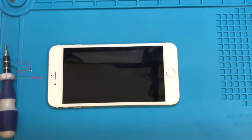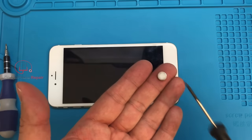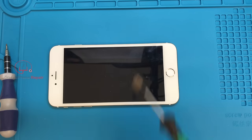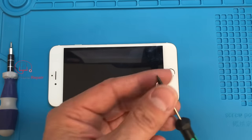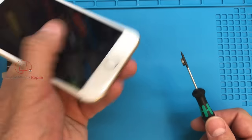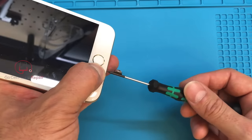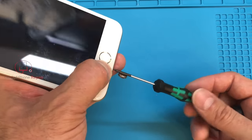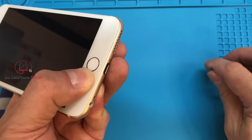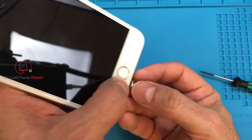I can go back and magnetize again, or I have another option — a rare earth magnet. If you haven't seen these before, they're super strong magnets and you want to be very careful with them, especially when you're working inside of a phone. Now that we have a very strong magnet on the end of this, I'm going to put that slight pressure on the screen, put the blade down in here, and very gently without pushing against it, I'm just going to turn it and hope that pulls the screw out. I might even be able to get the magnet directly on the screw.